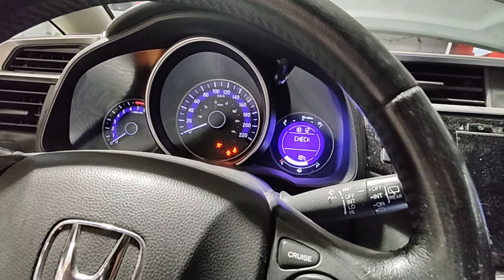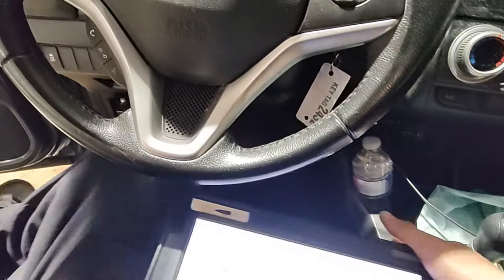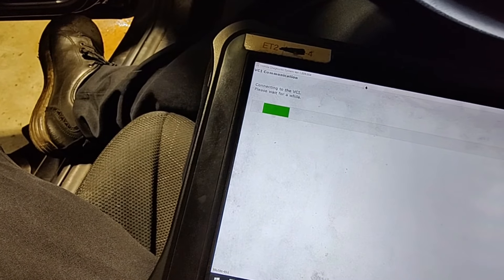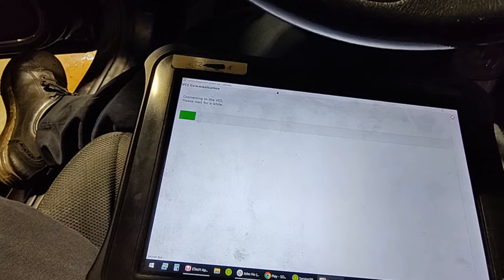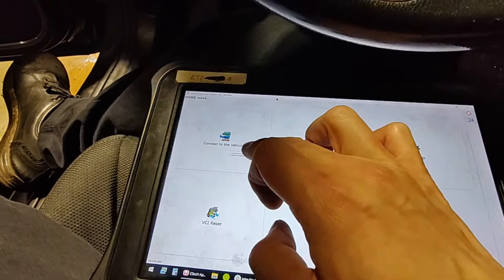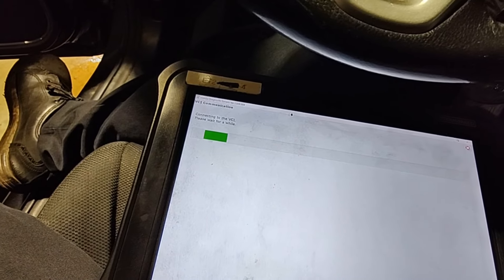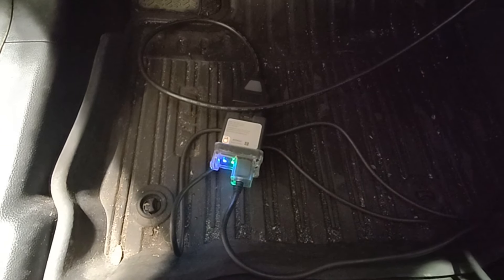I'm gonna take a look underneath the hood and check the starter and see what we got. Actually, let's scan it for codes and see, because if it has a warning on the dash it'll also have a code. What the hell - it does not want to communicate. We're not starting, we're not charging, and we're not communicating. I got the lights, and when it tries to communicate the little orange light starts flashing in the middle, and then it doesn't want to communicate, so we have an issue there.